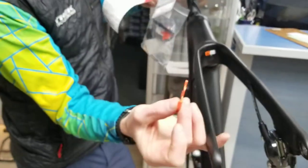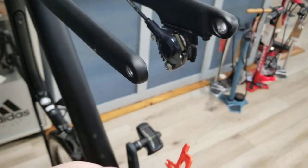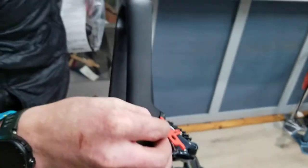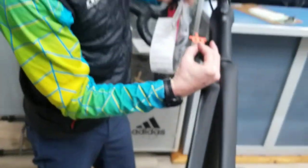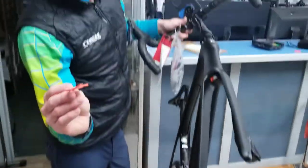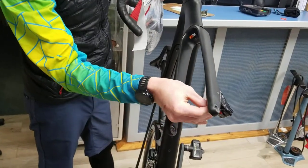Notice how it's got a little L shape. The L shape is going to go towards the inside. The back part is going to line up parallel to the edge of the brake pads. The little clip piece is going to clip into that right there. I'm doing all this by myself because you're going to have to do it yourself. All I do is stick my foot behind the rear wheel — now the bike won't go anywhere. I'm going to take this pin, line it up with that slot, and slide it in.